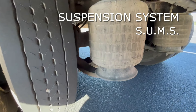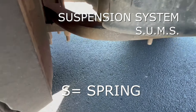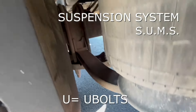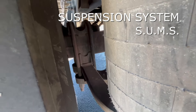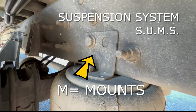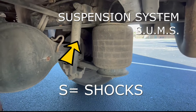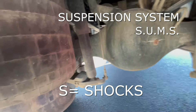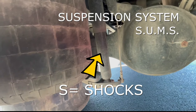We're behind the rear tire and we're continuing to check our suspension system. We have our spring on the rear — I want to make sure that it is not cracked or damaged. Our U-bolts — you can see them right through the gap there — you want to make sure they're nice and tight on that spring. We also have our mount — I want to make sure that that is tight — and then also our shock absorber. I want to check that top and bottom to make sure that it is tight on both the top and the bottom.